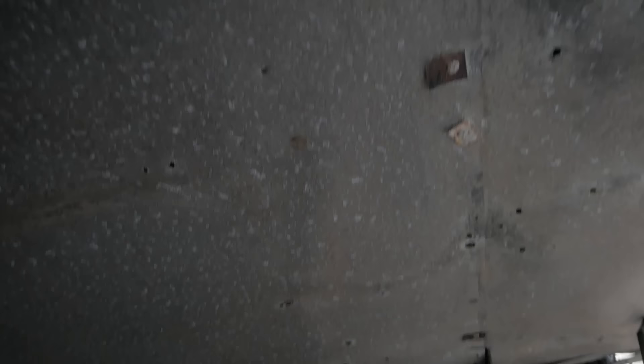Okay, so the propane wires are off — that probably ran the furnace, hot water heater, and the fridge. The next step: you see all these rivets. It's funny how they put a piece of aluminum — like an aluminum washer — and it was common for these belly pans to shake back and forth once they got loose. It keeps it from rubbing a hole through the head of the rivet, just goes through the aluminum. This will not be a whole lot of fun because underneath this belly pan is insulation and probably dead animals and poop tanks and all kinds of grossness. I'm going to put on some safety glasses and just start pulling off this aluminum.